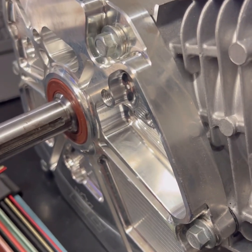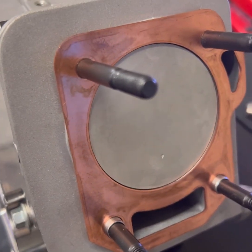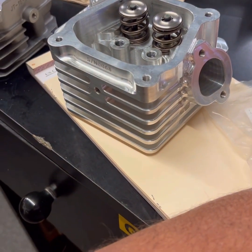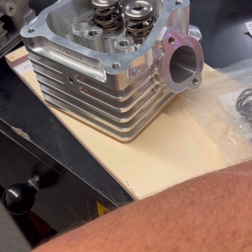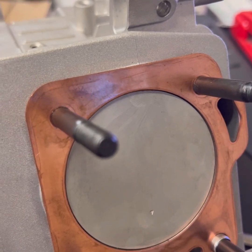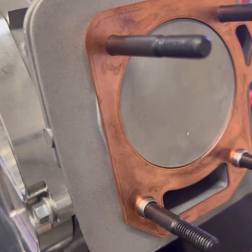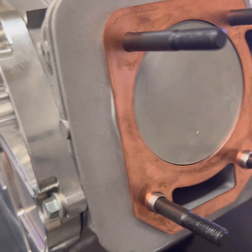This way we'll get to use that nice billet side cover with a Wisco piston. I'll just spring for the Wisco piston and rod, and we'll do our 236 a little more appropriate for that billet cylinder head. We'll have it cut, get some valve pocket cutters, and do it the right way. We can jack the compression up if we want and make that thing proper. This guy here — no way around it, that's a cast piston — and we'll run that with the big valve head. We'll run the smaller 272 cam in it. It'll have plenty of compression, plenty of power, and we'll get our bike running.